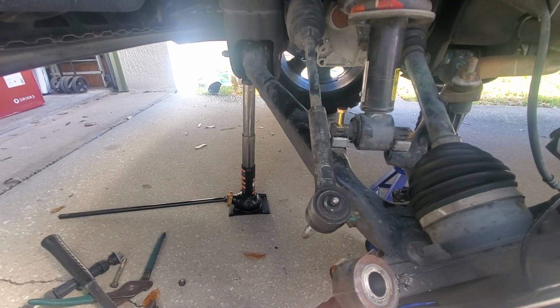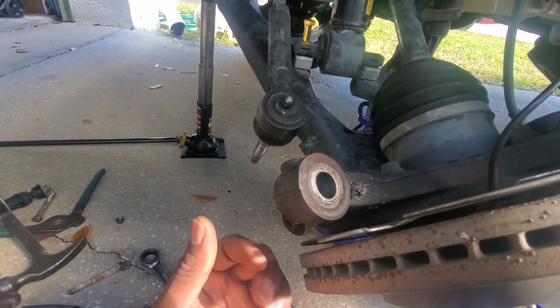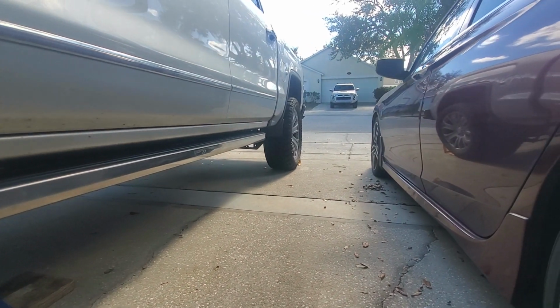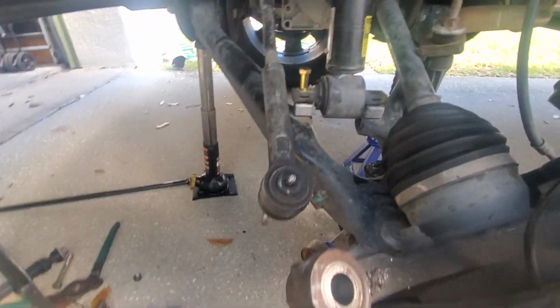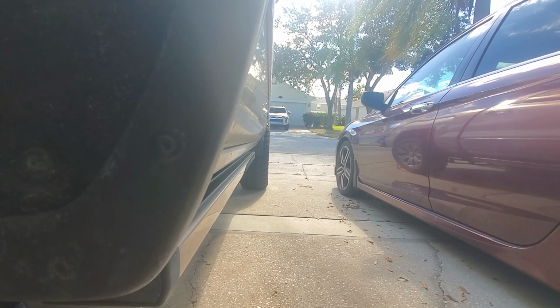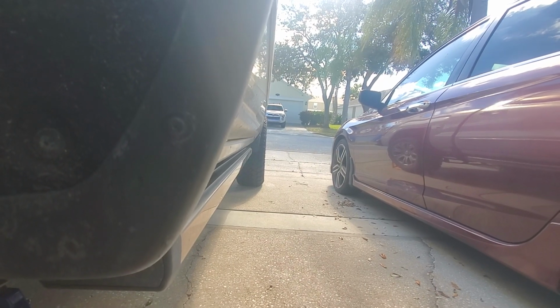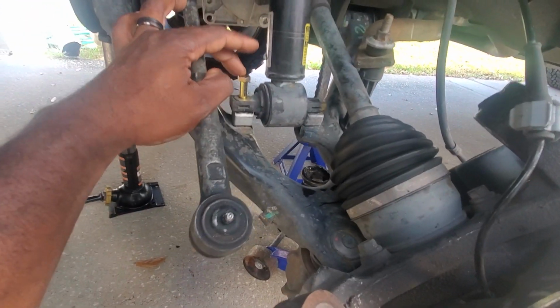I mean, most people get aftermarket wheels that have a different offset that pokes out a little more, so they don't have to deal with the rubbing. But these are OEM 22s that came with the Denali, and I want to keep it flush to the body line of the truck. These are 35 12.5 R22s. These are Rough Country Overlander MTs. But yeah, we're adding new hardware here.